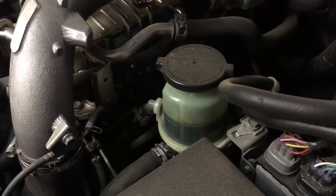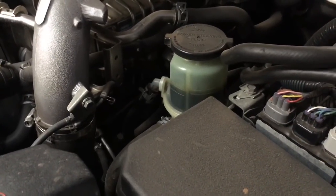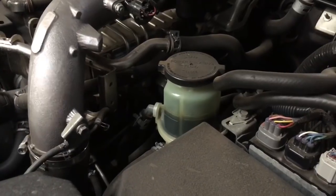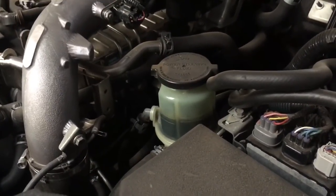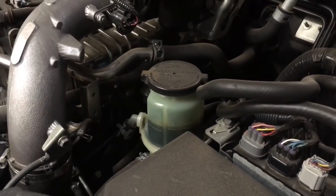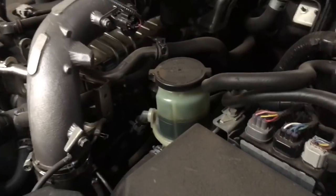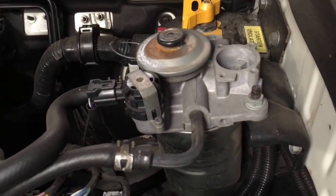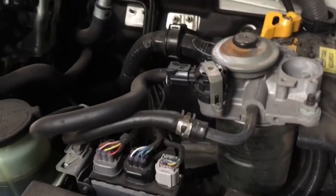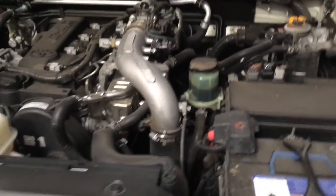You can check your power steering fluid level on the 150s without too much trouble. Sometimes there's a very slow leak at either the pump or the rack — the rack can leak slowly into the boot. If it's slow, it's probably not worth the big expense of replacing it; just monitor and top up. The pump seal can leak into the engine too. For the fuel filter, I suggest changing it every 40,000 k's rather than waiting for the warning light. There's good filtration between that filter and the one at the back.